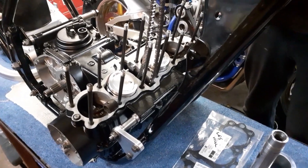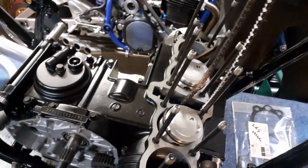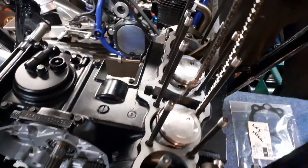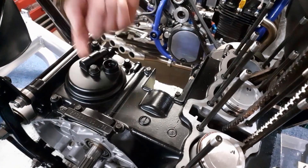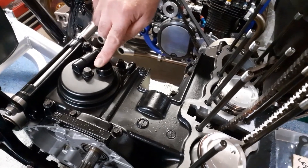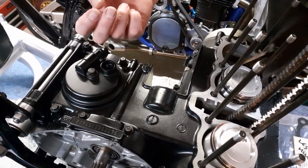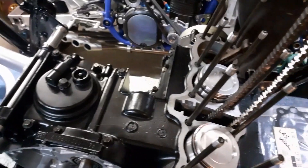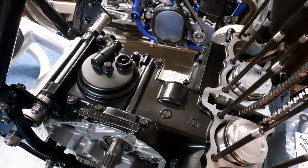One thing I noticed having worked on a similar engine is I really like this breather top — the breather exit is going sideways rather than straight up, because the plenum chamber is here on the turbo so they couldn't have it coming up vertically. They put it out sideways, and they've also incorporated this lug — on the bottom of the plenum there's a rubber tube like a grommet that locates the plenum so it can't move. It's a great idea — they're only made for the turbos.